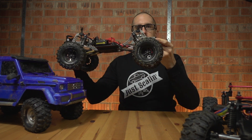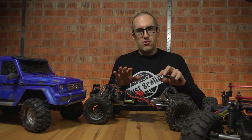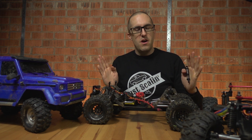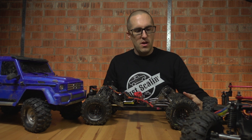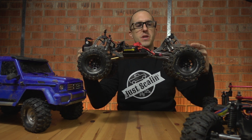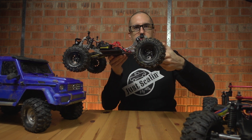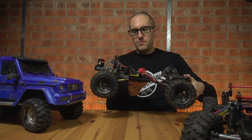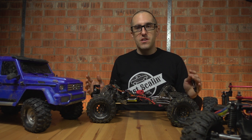On this truck it actually has a really laid-down shock and the reason for that is articulation. This truck has a really low center of gravity because I'm running the suspension super low. I've got my shocks laid down which brings the wheels higher up into the chassis because you've shortened the overall height of the shock by tipping it over, but through wonderful geometry you end up getting more clearance because as you tip a shock over inboard you increase the amount that the wheels can move through their arc of travel. The slightly wonky spring rates are the downside, but the extra articulation and the lower center of gravity are the upside — like everything, it's a complete trade-off.